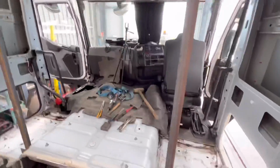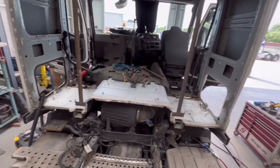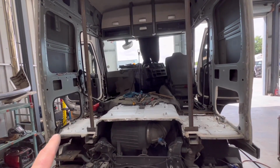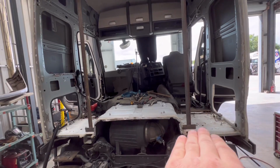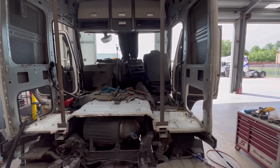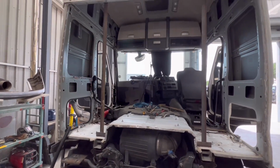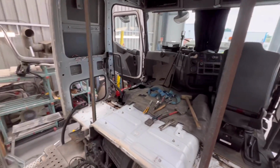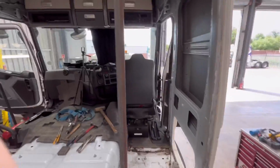And definitely needed them post support, because as you can see, if I stand on the back here gently, carefully, this whole cap is now supported. All the weight of the cap on the back is on them two points, but it's a flat floor, so if I didn't put them posts in, that floor would just go like that. Definitely it will sag, because there's no strength, it's only flat. So I put them posts in, which I made for the previous job, and just have to prepare the new panel, repair this corner and that floor and start putting it in. So let's do it.